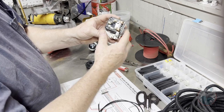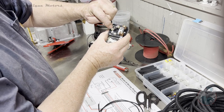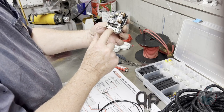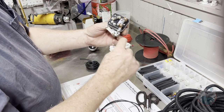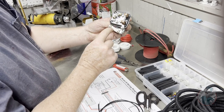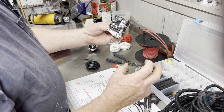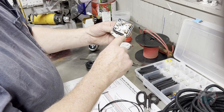and this is providing power into the switch. Once it goes into the switch, this is the headlight, and then there's a resistor that goes down to this lower portion. The rear headlight, the rear light, goes into this number two switch. On the switch is this resistor bar. This is not used if you have a four terminal regulator. If you have a cutout, then it goes through here and it uses the L and the D through this resistor on this little bar to determine whether you're getting a high charge or a low charge out of the distributor. But in our case, the four terminal voltage regulator is going to do that work, so we're not going to use this piece. So we're going to connect eventually the line from the voltage regulator into there.